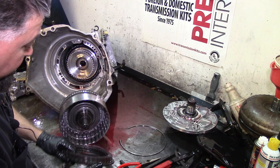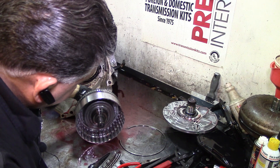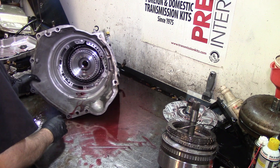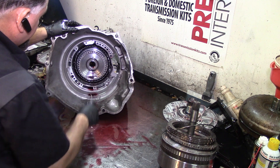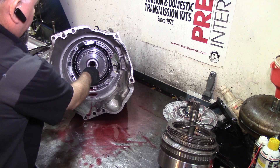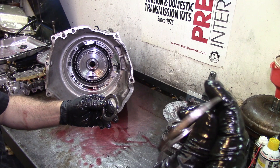It's dirty, man. I have no clue — it might not have been properly serviced. There's the bearing. And then — oh, it's broken! Wait, no — it was just dirty. So the spacer goes in the drum and then the bearing has a little lip right here that holds right there on that edge of the drum.